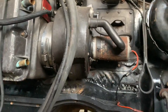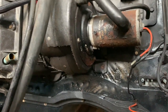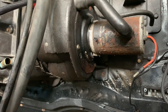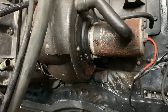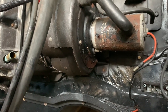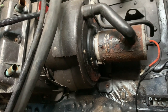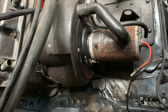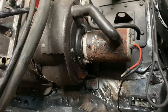So I know a few people have had this happen to them, and I will be the first to tell you I messed up. When I pulled the motor, the bolts near the bottom of the bell housing weren't removed. There were two of them left, which resulted in me breaking the bell housing. And in turn, when the motor was being jacked up on the hoist, it resulted in the hamster wheel getting crushed.